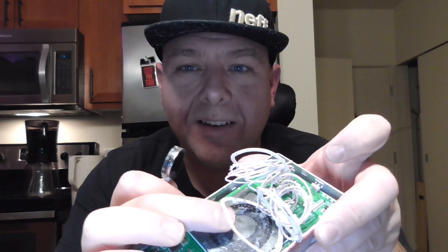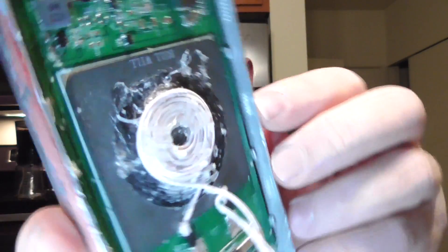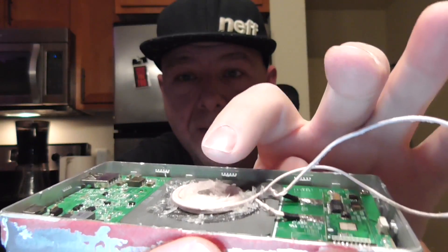I know it requires some circuitry for wireless charging to work. I'm just hoping there isn't some sort of weird encoding in there. I would assume they just shrunk it down to a weird size so it wouldn't work. It's ingenious that they make the whole coil the exact size of the center, which pretty much guarantees it's not going to work. My arms and hands are wasted now — it was a lot of work, but totally freehand with a hot glue gun and a flat blade screwdriver I shrunk this coil down. What we have here is two layers.